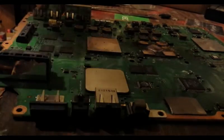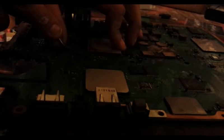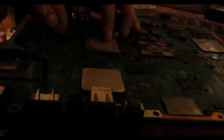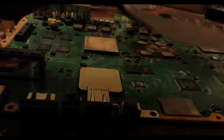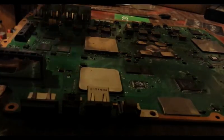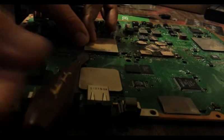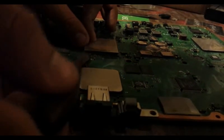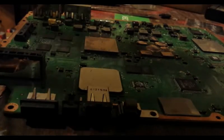Let me stand up so I can get a better grip. We're going to start on this side here — you push it in and then it just slides. One side done. Another side done, and this is going under really easy. I haven't even heated it up; this is 100% dry epoxy. Third side here — I try to keep my finger along the edge when it's going under, so that if it slips out it'll hit my finger instead of anything on the board. It is starting to lift a little since we have three sides of the four done. And the fourth side here.